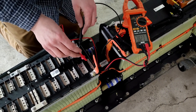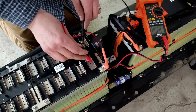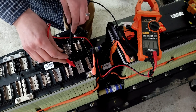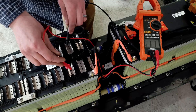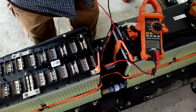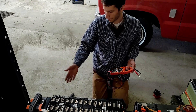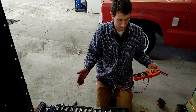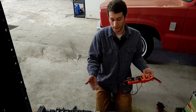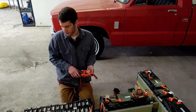I'm going to do it backwards so it shows negative, but it says 3.829 volts. I can go ahead and jump up to the next set — 3.83. That's pretty balanced. 3.83. You can do that all the way down — 3.83. That's awesome. I always expect them to be pretty well balanced — the Volt does a great job at balancing them. When they're unplugged from the car, there is no parasitic drain on the circuitry that I know of. I've bought one that sat over a cold winter in a salvage yard for over six months and it was sitting at 3.8 volts and has been perfect. I actually have it in this car.